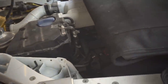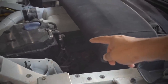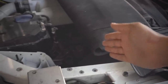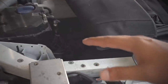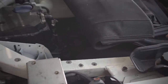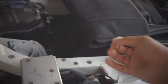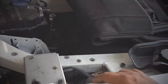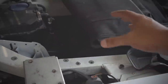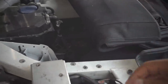There are no leaks anywhere in the system. I checked this after running the car for quite a long time, and then I realized there are a few issues with the fuel line itself. These fuel lines are actually subject to odors — these fuel lines actually have an out-gassing symptom. It's not even a problem; the out-gassing happens from the additives of the gas, it's not even the gas itself. So there's no risk of fire, it just smells a little bit like gasoline. I'm using Russell lines and apparently these have an out-gassing problem that a lot of people have reported. But I'm really relieved to know that I don't have any fuel leaks at all, because that would be very catastrophic. I will change the lines out in the future — something like an aeroquip line — just so I don't have that smell.